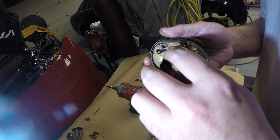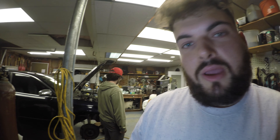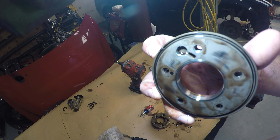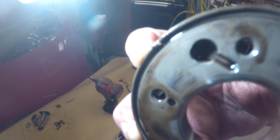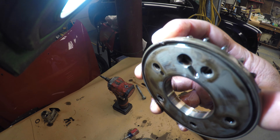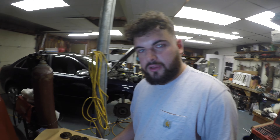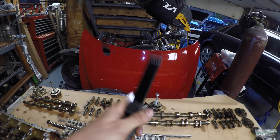I'm glad we did this, because if we did all the work, the timing would just jump — probably on startup. The phaser wouldn't work right, and the camshaft position sensor would be throwing codes. This is so shocking — that's shot. We're gonna take the other one now.